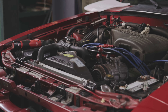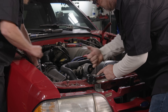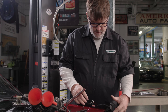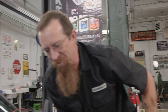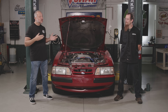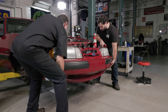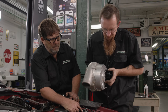After a thorough front-to-back inspection it was time to let Junior and the crew rip into the old Mustang and prep it for our ProCharger install. Before that, the guys had to disconnect and remove a bunch of ancillary parts from the front and top of the engine to be inspected and reused during final assembly. Of course, every car has at least one Mouse House. First step is to get the hood out of the way so we can all fit in here. We've got to pull the front fascia off to get the intercooler in, pull the battery and relocate that, pull the whole intake system, and then mount the supercharger. We're doing the blower first.